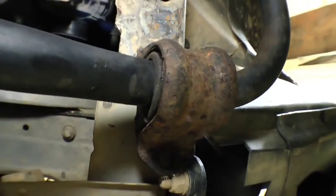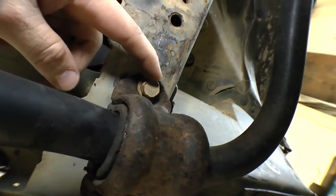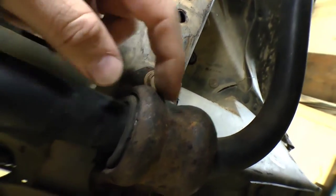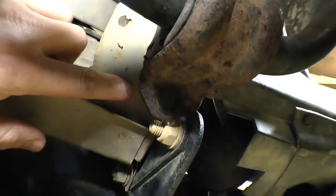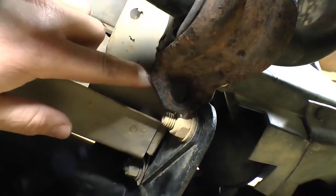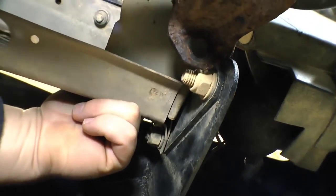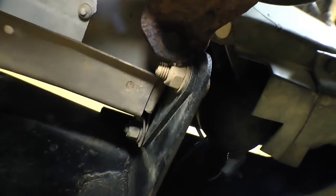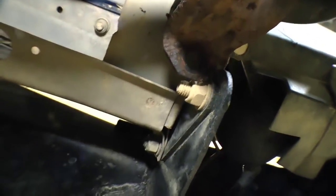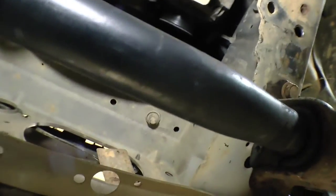I'm going to take this bracket back off. I've got that bolt right there tight. I'm going to take it off and bend this tab at an angle so I can set it back in here, and I'll do the other one the same way. Then I'll make a mark where I need to drill a hole. I think if I drill a hole right in there, I can get a nut in it from the inside of the frame from the front. I've also got a hole right here - I might be able to put a tack weld in and weld it to the inside of the frame. The frame of my XJ is actually in pretty decent shape.